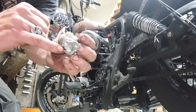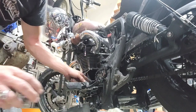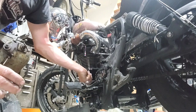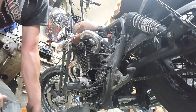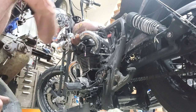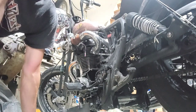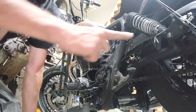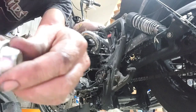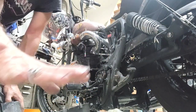It pushes the little ball that's in here against a push rod that sticks out of the side of your transmission housing, reaches all the way to the other side, and releases the clutch. So it pushes the rod using the twisting motion by growing its length — that's how it fundamentally releases.